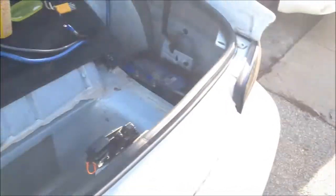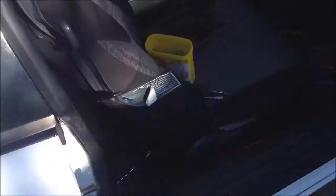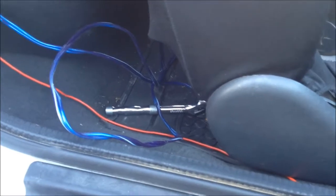I've noticed I've got some rust on the floor because my T-tops leak and I had water in it last winter when it sat outside. I'm definitely going to have to pull the carpet up. I'm thinking about getting new carpet — I don't know yet, this carpet's not too bad but there are some stains. I might replace it. I'm going to fix the rust — it's just surface rust — grind it down and put some POR-15 on it to save it.